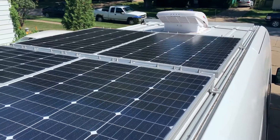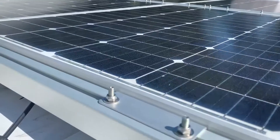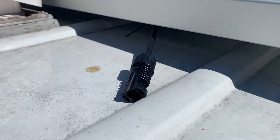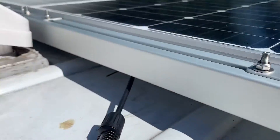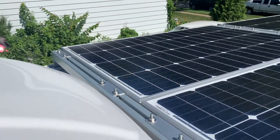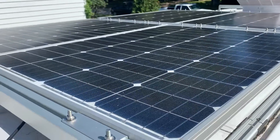Okay, it's all done again. This time they're all wired together in series though, so I'm pretty much done up here. I've got a cable coming out the back for the female connector. This is the negative lead on the driver's side. There's the positive lead, so now I just need to put together my cables going down to the charge controller.